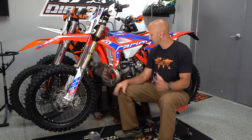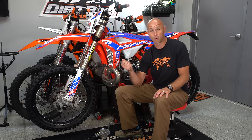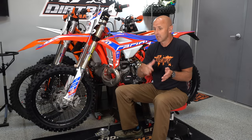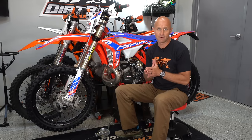In conclusion, the Smart Carb does offer some advantages but you pay $200 to $300 more for them. For more context: I've put the Lectron on no less than 10 bikes and own three currently. Generally I don't even have to tune the Lectrons when I get them — at most a quarter or half turn of the metering rod once. Once installed, whether at 3,000 feet or above 10,000 feet, with temperature swings from 30 to over 100 degrees, the Lectrons have self-metered flawlessly. The Smart Carb has also worked flawlessly, though I haven't put as much time on it.